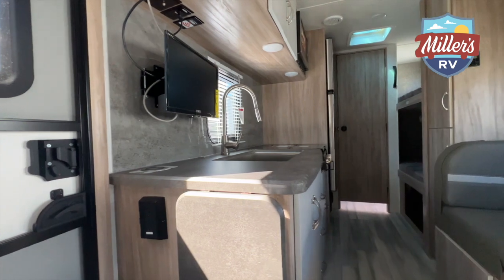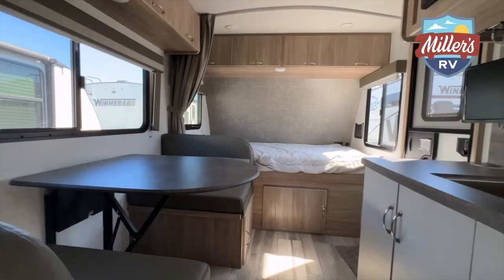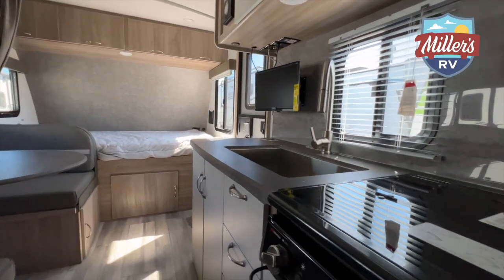Now we're on the inside of the 1800 BH Micro Mini, and I wanted to mention a few of the measurement features on this coach. We talked about the length outside — this is a seven-foot wide coach, not a full eight-foot wide, so it's designed to be towed by your smaller vehicles. This coach's dry weight, even with the options we have on it, comes in under 4,000 pounds, so anything rated in the 5,000-pound range or up can pull this. Your sport utilities with the V6 will be rated at 5,000 pounds minimum, so it does open this coach up to a lot wider market.